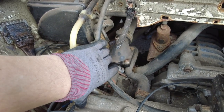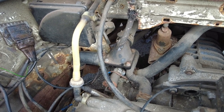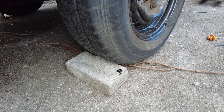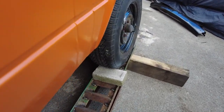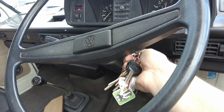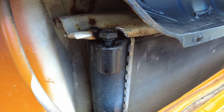We have to get it up to temperature so the thermostat here in the engine bay opens up and we have full flow to the radiator. Hopefully if there's any airlocks in there, that'll help get that air to the front of the system, and obviously with the nose being so high, the highest point will be the radiator at the top. At this point you need to be pretty careful — if your handbrake isn't really good, your nose is up in the air and you're about to take it out of gear, because the engine has to tick over in neutral. So it's highly recommended you block the back wheels just to make sure the van can't move. While I'm waiting for the engine to get up to temperature, I'm just going to double-check and make sure I've got no leaks anywhere.